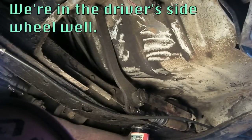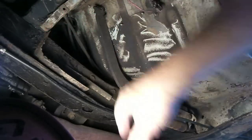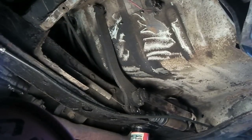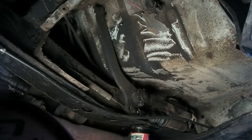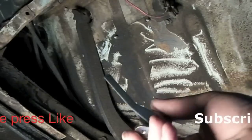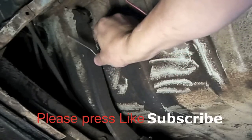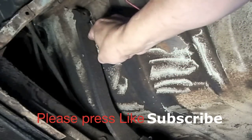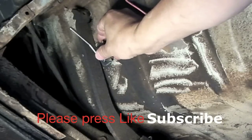This is the inside of the wheel well in the front of the car. I've removed the splash guard that goes here so I can get to the brake assembly. This is the brake pedal — you push on this, it moves forward and it puts on the brakes. The master cylinder is back over here somewhere. I'm going to put this switch on the floor here, mounted about here, and when the brake pedal goes forward the switch will move and turn on the brake lights.